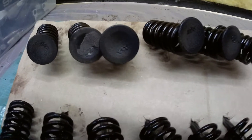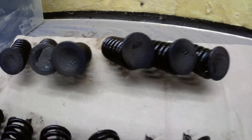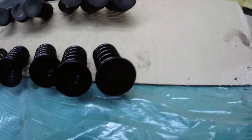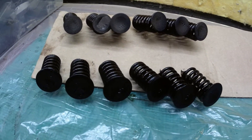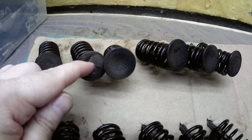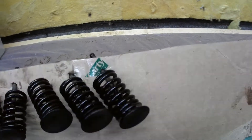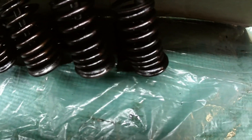Now that the front valves are out, let's take a quick look and see what they look like. The intake valves are pretty gummed up, and in fact there's some really hard buildup on them. I'm not exactly sure what that is. The exhaust ones looked about like I'd expect them to look. A quick internet search seems to imply that this might be valve seals that are leaking oil, so I guess we're going to be adding that to the list of parts that we need to get.